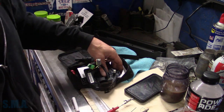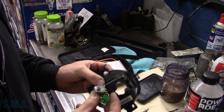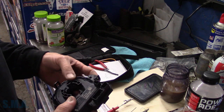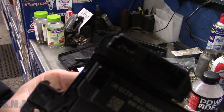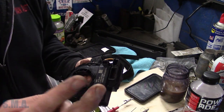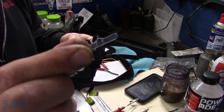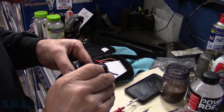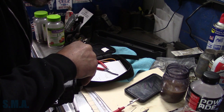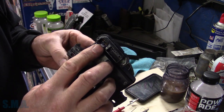Alright, the clock spring is out in the open. There is a bit of a dilemma — you would think you could just ohm-test from here to here as I stated, however this has a shorting bar in it. Down inside on the pins around this connector, when you unplug it there's a metal bar that shorts across them. What you can do is take a little plastic tab, like off a piece of packaging, slip it down in there between the shorting bar and the pins, and that will allow you to do your testing. Those pins are inky-dinky so it's going to be hard.